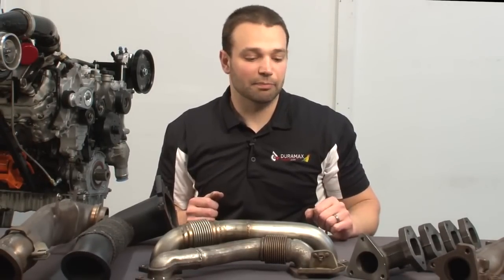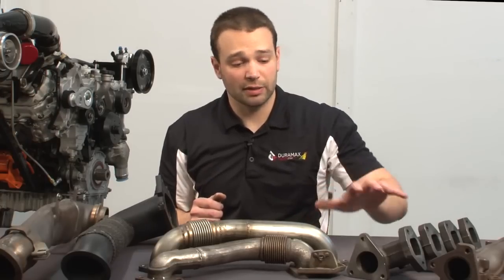The benefit of having all these pieces on the truck is that EGTs go down, spool up goes up, the truck is much crisper, nicer to drive, and it also has a throatier tone to it. Especially in situations where you have twin kits or turbochargers operating at high pressure and high drive pressure, it's important to have these high-quality exhaust pieces so that you don't have leaks and you can get that flow quick to the turbochargers. I'm Nick, thanks for watching.